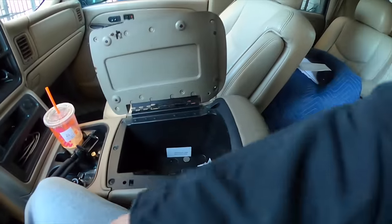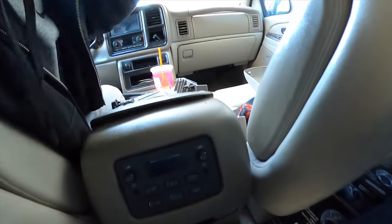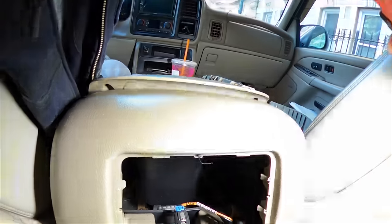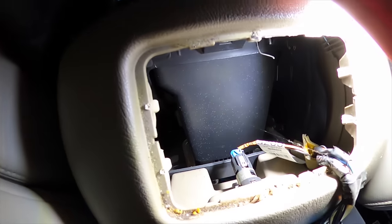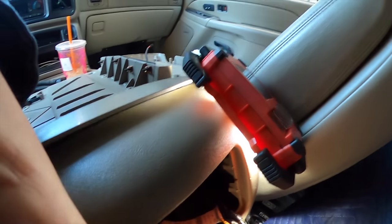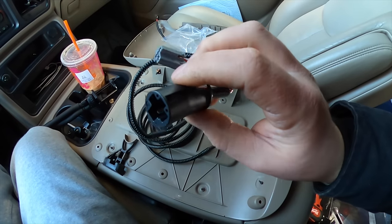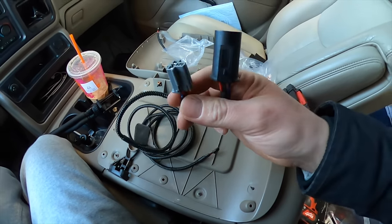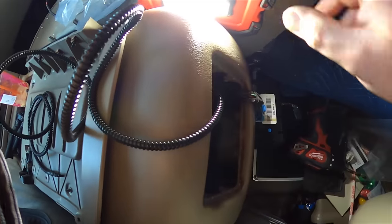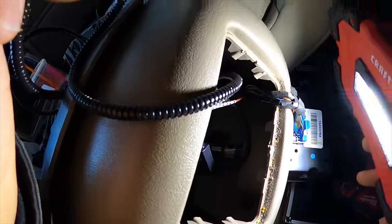That's it for the drilling. Next step is to come in the back and pop out the rear controls. Take a screwdriver and pop it out — easy enough. With that out, you can see the power port we're going to be tapping into. Reach in here, press the little black plastic tab on the back and slide that connector right out. Then take the fused Boost Auto Parts plug-and-play harness, plug the wire from the car into this part, and the gray one goes back into the power port.